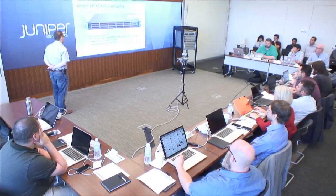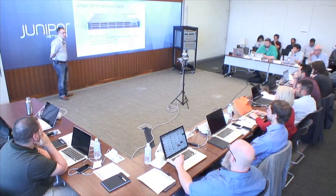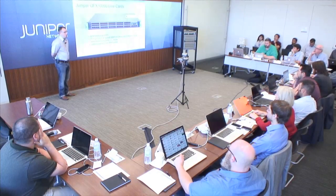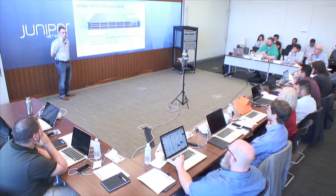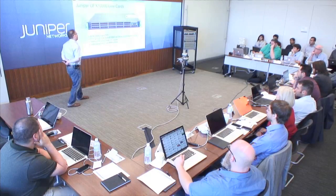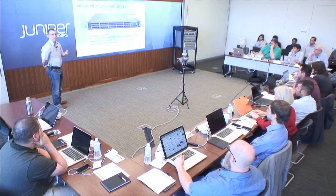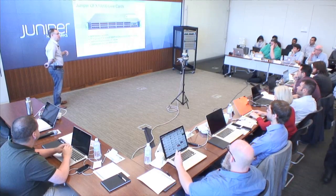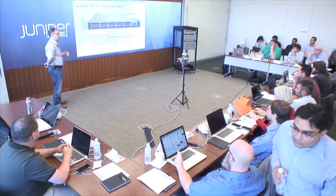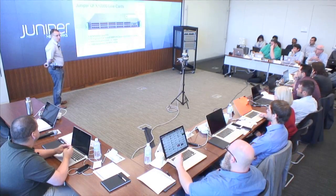The last line card is a native 10-gig. Typically the use case might be that you want to terminate a bunch of WAN connections or colored optics at 1 gig or 10 gig. We can do so with this line card, and there are also six more ports of QSFP+ that we can turn into 100 gig if needed. A lot of different combinations in terms of connectivity — whether it's hosting, software as a service, or collapsing your WAN. We can do it all with this one switch.